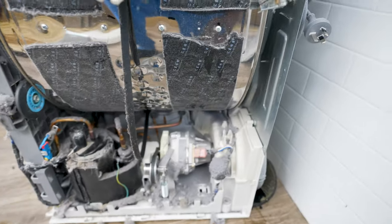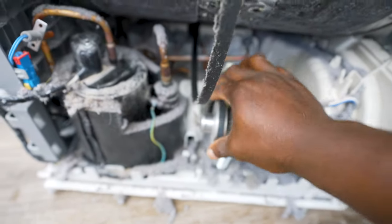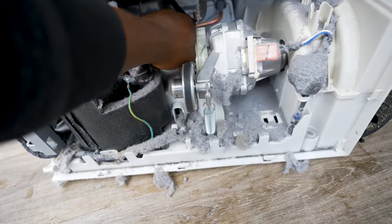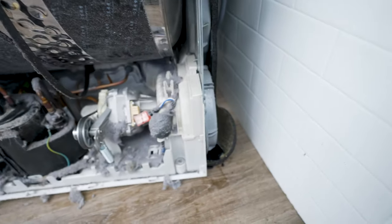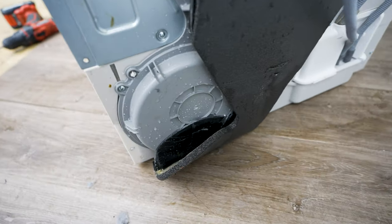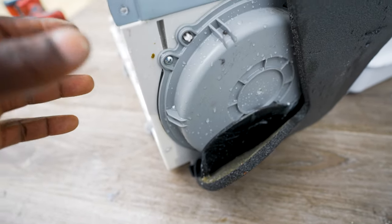So we're going to find out why it's so tight, and I think I know why. This is your motor — try to move it by hand and you can feel it's tight, it doesn't want to move. Another thing that happens with these is sometimes there's a fan at the back which, because of the heat, has expanded and is hitting against the housing. Hopefully it's that — failing that, it would be the motor with a failed bearing, meaning it's seized.